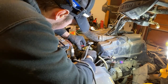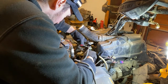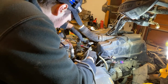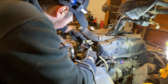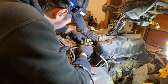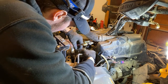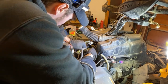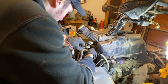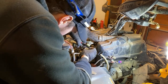So with these plugs here, I got to look at the wiring diagram from the factory, because unfortunately what they did is they made it this way. There's like 4 plugs here that all look exactly the same, and I think they will all technically fit. Yes, so they're basically the same plugs here, so I gotta look up the wiring harness. This one should be this guy here. It should be, because it's the only one that's a female to male. Make sure we don't have any dirt in there. Nope.